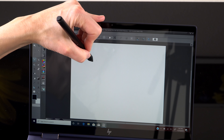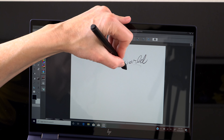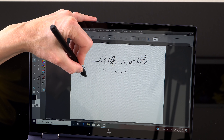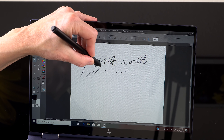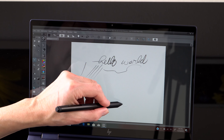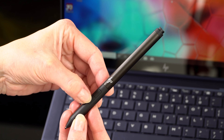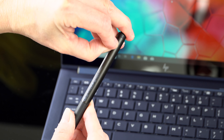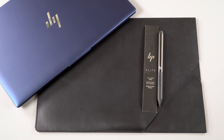With the Elite Series, HP uses Wacom AES pens versus the Ntrig digitizer technology used in the Spectres. HP doesn't do the greatest job with Ntrig in terms of smoothness of lines and line jitter on diagonals, and Wacom AES is a bit better. It's also a rechargeable pen that charges over USB-C — it comes with a little USB-A to USB-C adapter. You have two buttons on it and a few pen settings. The pen is not included in the box, so unlike the Spectre X360, it's a $76 extra charge, but you do get a leather black sleeve included.